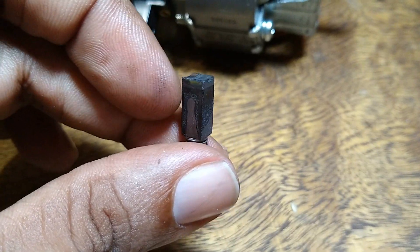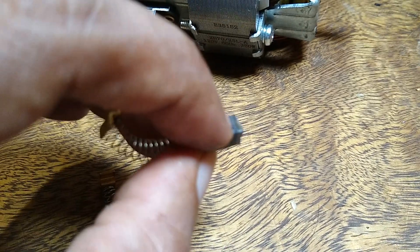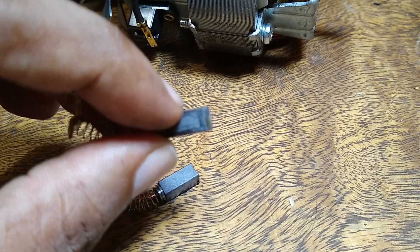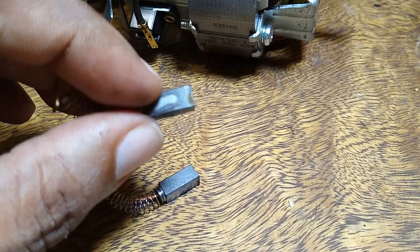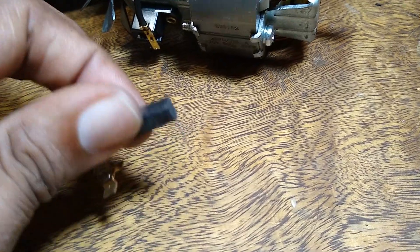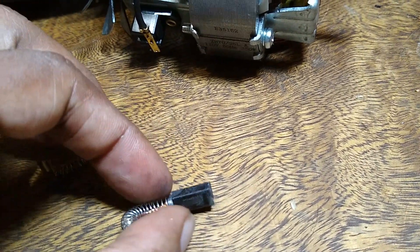You can look at the brushes and tell you exactly what is going on with it. If you notice there's a little discoloration here, that's where the burning was taking place. When you smell something burning, that's what happens — the heat actually gets into that. So these brushes are no longer good; I'll have to replace these once the commutator is okay.